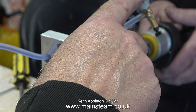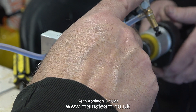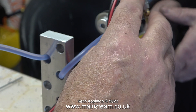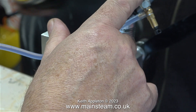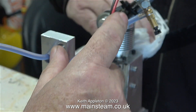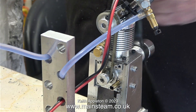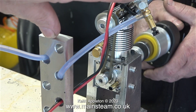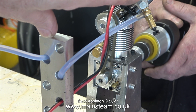The engine is definitely sucking fuel now into the carburetor — when I put my finger over the end of it the engine note changes and it actually does start to fire very slightly. I would like to mention though we are running the engine in reverse; the polarity of the starter motor has been changed around on the power panel. This is good for two reasons: one, I do believe the timing of this engine is set for it to run in a clockwise direction, and also by running clockwise the propeller doesn't fly off. I can see smoke.